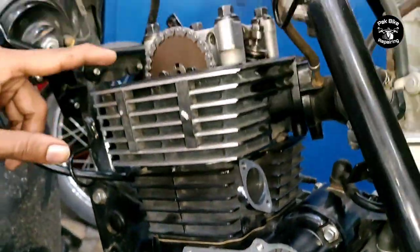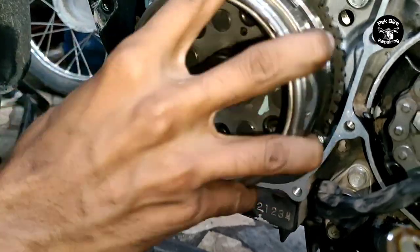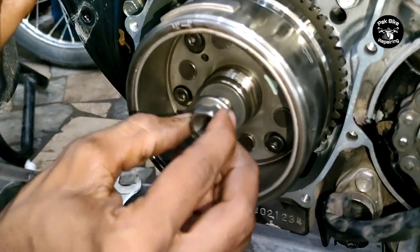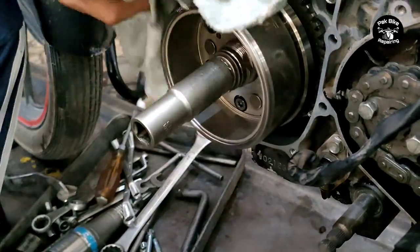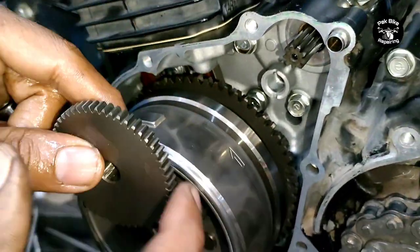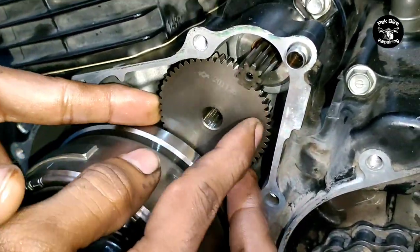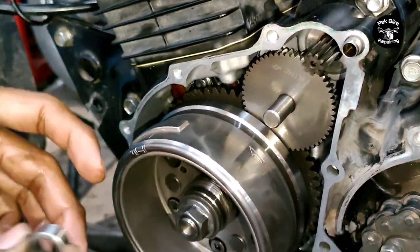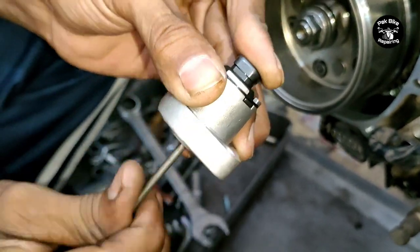After timing adjustment, install the magnet. The main procedure is to fit the bearing inside the magnet, then adjust the magnet onto the crankshaft. There is one plane washer and a nut. If you tighten the nut with an impact gun, you won't need a magnet holder. If using a spanner or socket manually, you will need the magnet holder. Then fit the starter driver - its purpose is that the self-starter is attached to it and the magnet is also attached. When you press the starter button, the self-starter rotates the driver, which rotates the magnet, and the engine starts.